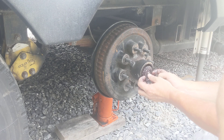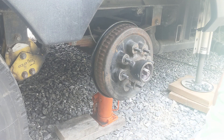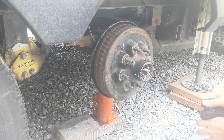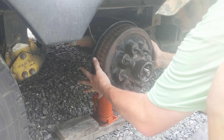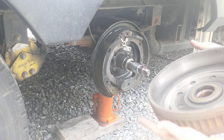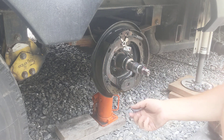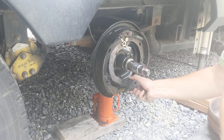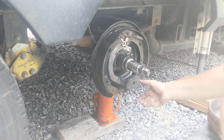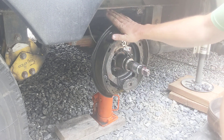Set that off to the side. Easy way — just grab it a little bit like that, most of the time it will come out just like so. Here's where you want to keep the hub as clean as you can — don't put finger marks on the inside of it. See, we got a little brake dust in there but we'll get that all cleaned up. The reason I actually got in here is because of how loose this is. There's supposed to be a collar on there and that's what's making my brakes hang up, so we're going to remove this.